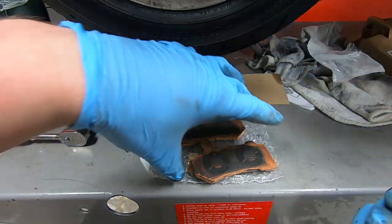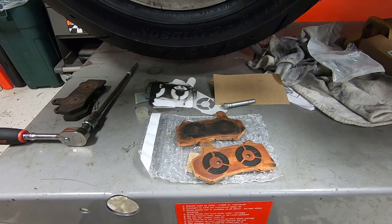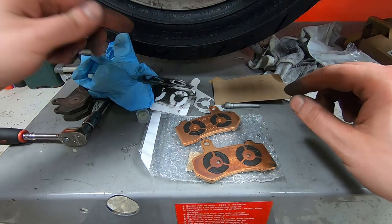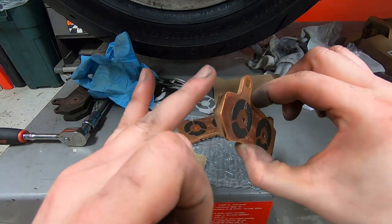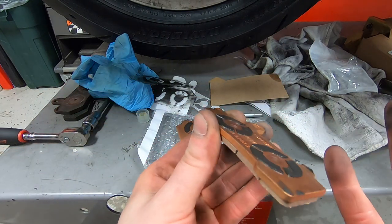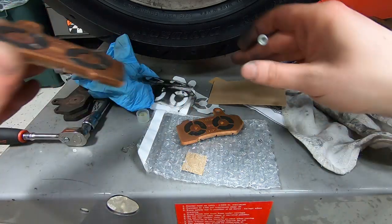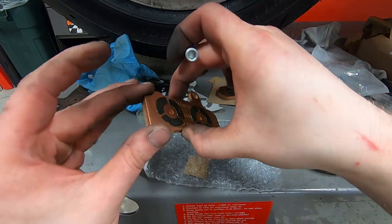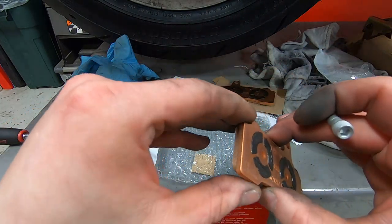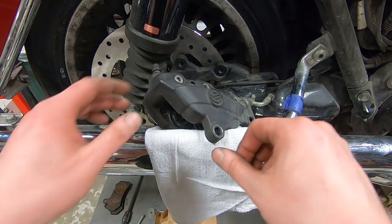Alright, so that's pretty good. And then you peel your little templates off. I'm going to use my actual hand saw. It just makes it easier. And then if you got crazy, just go around the sides. Clean off any residual, so that it doesn't accidentally make it onto the actual brake caliper, or onto the actual pad face. Put that somewhere clean. Same with his friend. All right, that's looking pretty good. We're going to find a clean spot for him, like that. All right, now that our brake pads are ready to go, our caliper is ready to go,